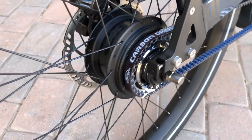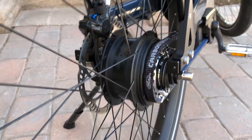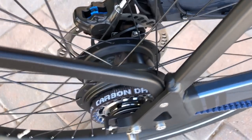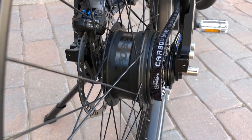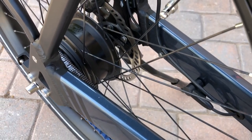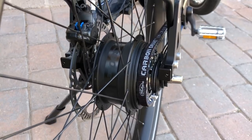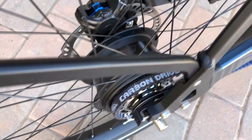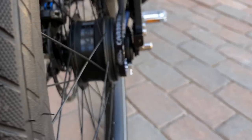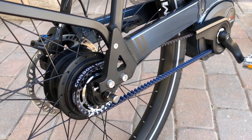Once the power is delivered to the rear wheel, it's routed through the NuVinci N380 CVT, or Continuous Variable Transmission. This doesn't have any specific gear ratios, but it has a range of 380% between the low and the high end, and you can dial in exactly what gear ratio you want to be in. On the handlebars there's a twist grip shifter to dial in that gear ratio. It's a really simple system to use, very smooth and quiet, and can handle a lot of power. You can shift either when you're pedaling or not pedaling. According to NuVinci, there's really no maintenance for these CVTs. Combined with the Gates Carbon Drive Belt and the Bosch Mid-Drive Motor, it's just a very cohesive drive system.